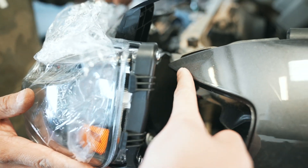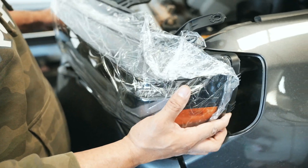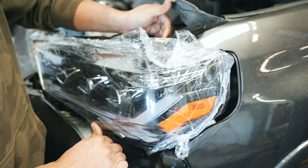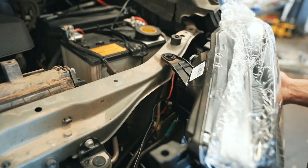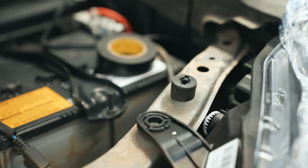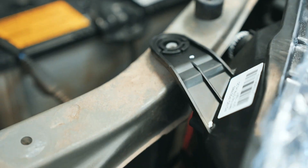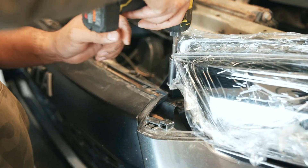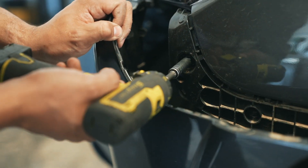Once again, be careful of this corner — it's going to scratch up your lens. I've done it myself on my own truck, so just be careful. Keep the film on the lens so that way it protects it a little bit if you do scratch it on anything. Then just slowly fish your way around all the parts and bumpers and everything, and try to line it back up with those factory holes and the one under there. It will pop into the little clear piece, and they all should line up to the factory locations. Then go ahead and reinstall all your hardware — don't forget the one on the side behind the bumper piece.